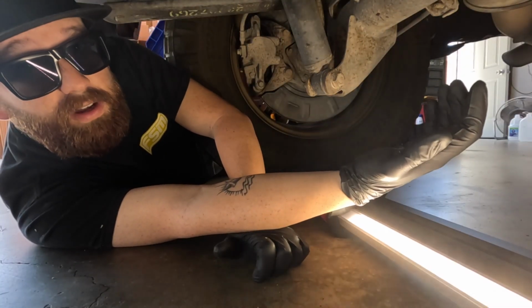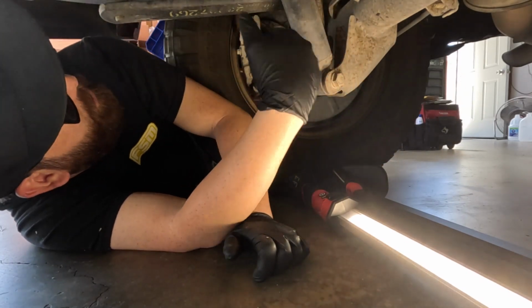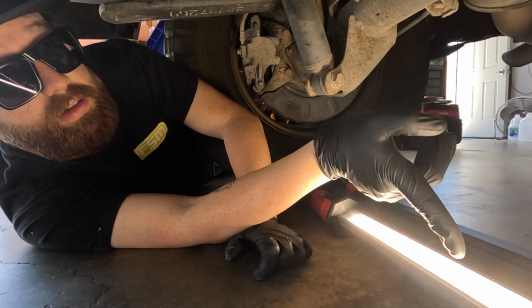Taking off your rear shocks is obviously very simple. We're going to be removing our lower bolt and our upper bolt, slide the old shock out, put the new one in. Another cool part about this video is this is my first video utilizing my new underhood Milwaukee light,